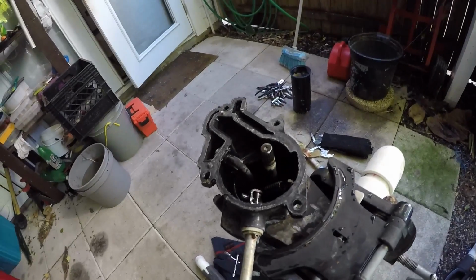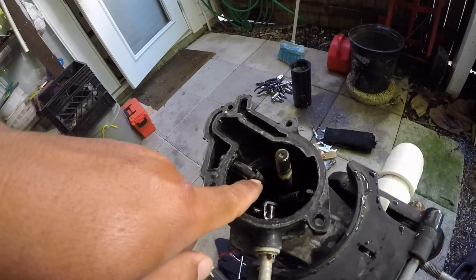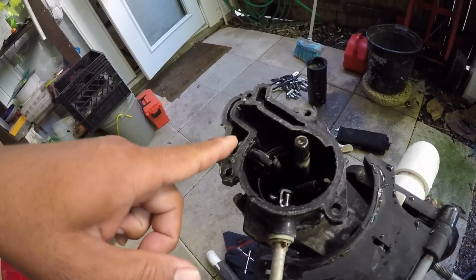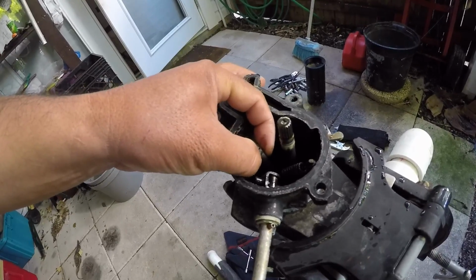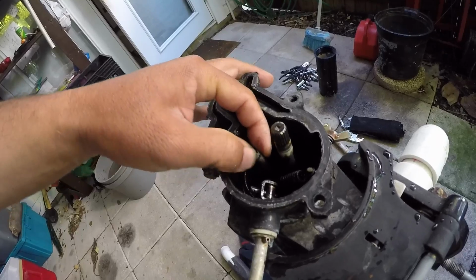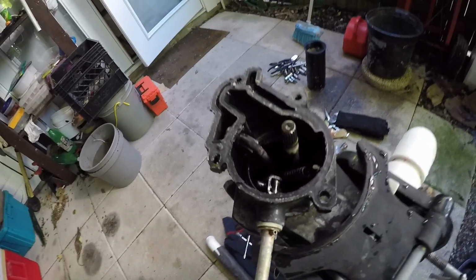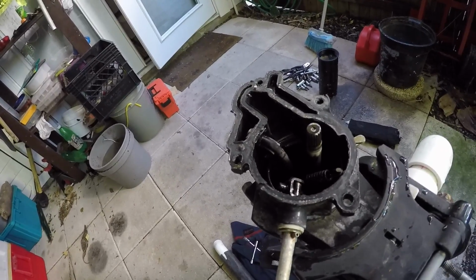We found out what the problem was. It wasn't the water pump impeller. This water tube pickup was broken. It was just sitting just like that. So that's the water that gets pushed through the cylinder head there. And that's just some copper tubing, and it just snapped right at that bend weak point. Corrosion, I tell ya.